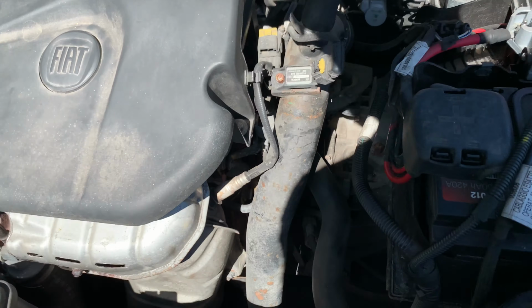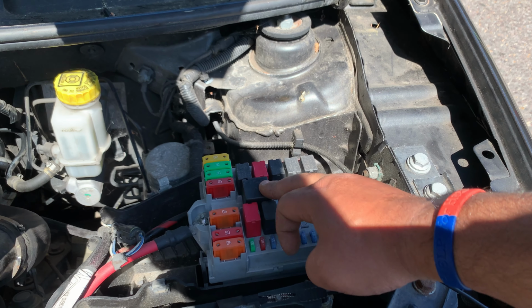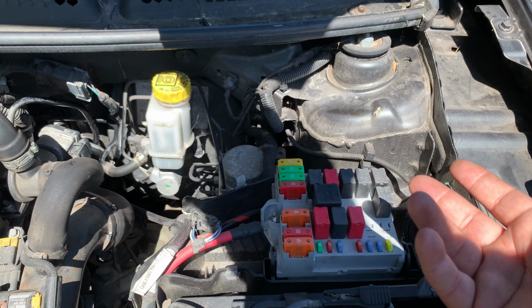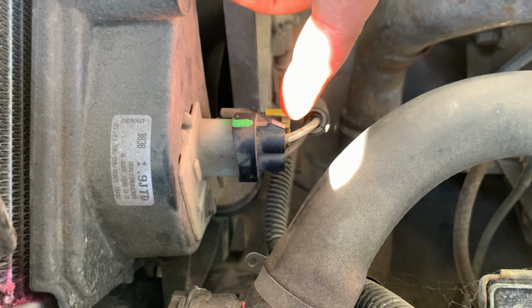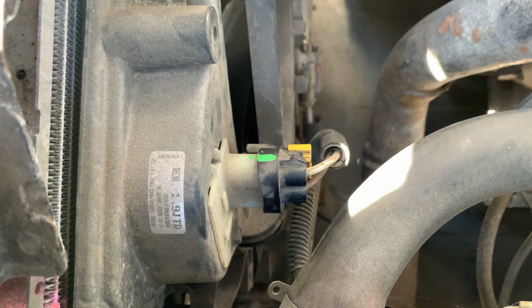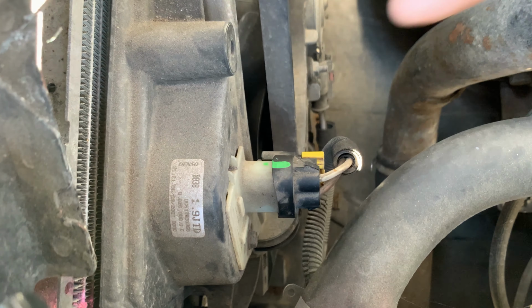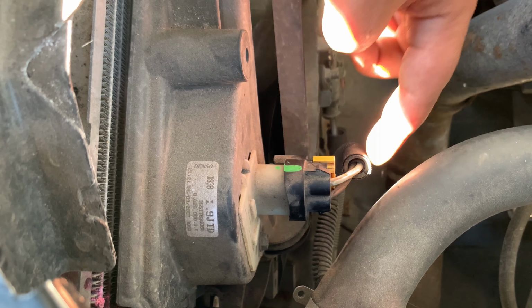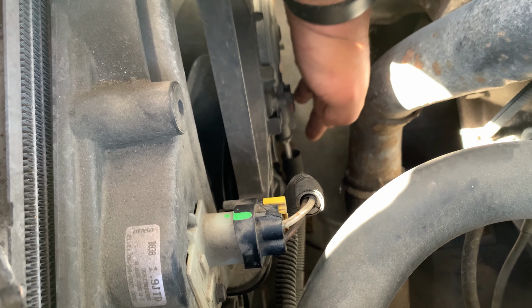Right, so this system is pretty simple. You have the 2 relays there. The ECU will obviously be commanding relay 2 or 1 by grounding the circuit, depending on the coolant temperature sensor and other factors. That straight connection there to the motor will be your number 2, powers and grounds. And then here you have a resistor for number 1 speed, and basically the motor is grounded all the time, and relay 1 is going to be activated like it's being activated. So you're going to have power coming in, going through the resistor and coming out, and this brown wire is spliced up with the 12 volts going to the motor.